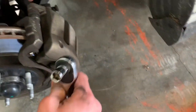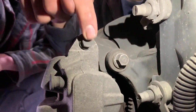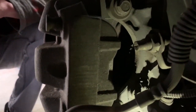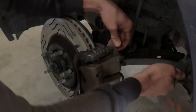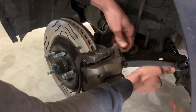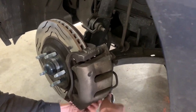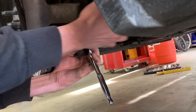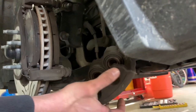We've got a bolt up here and a bolt down below. This bolt pops out and the bottom one right here. If you were going to replace the rotors, you'd take off this other big bracket right here and right here — but we're not replacing those yet. The caliper is going to come out like a bar. There it is.